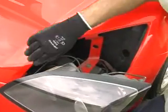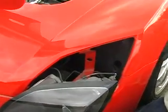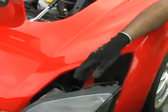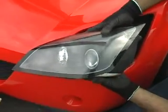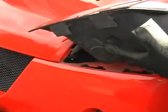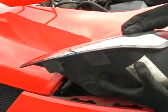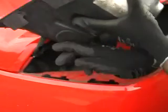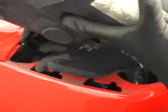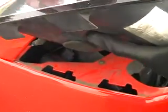there. So when I put this headlamp back, I'm going to show you how we can adjust it from the wheel arch. All we do is turn the steering wheel to the left so we've got some room, and we'll put it in. Now, how to replace the headlamp. At the bottom of the headlamp are two, I don't know what you call these, sort of lugs, I suppose, in one sense. But basically they will fit inside here. So you have two apertures here, just on the top of the bumper, and they'll fit inside there.